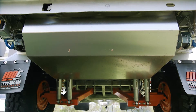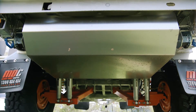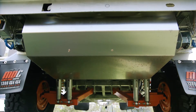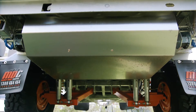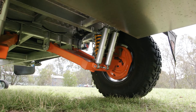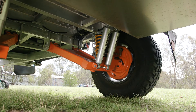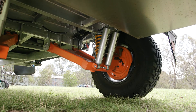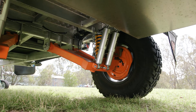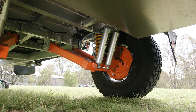At the rear of the camper, this is where you're going to find your 120 litre stainless steel water tank. It has a shroud over the top to help protect it, and a drain plug on the side so you can empty the water out when you're not using it. Underneath the camper trailer you're going to find independent trailing arm suspension with shocks and 12 inch electric brakes on the wheels — the toughest suspension you'll ever find in a camper trailer, able to take it anywhere your car will go.